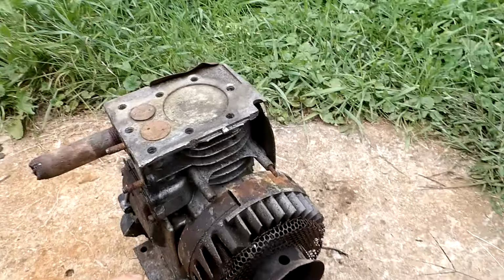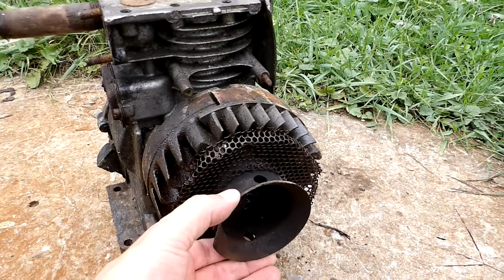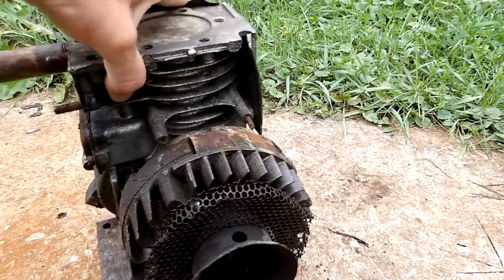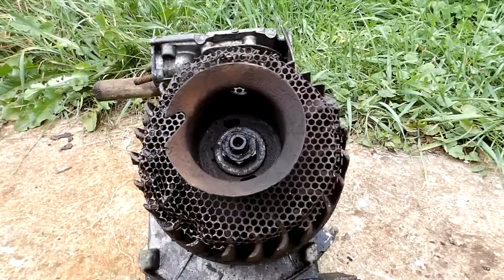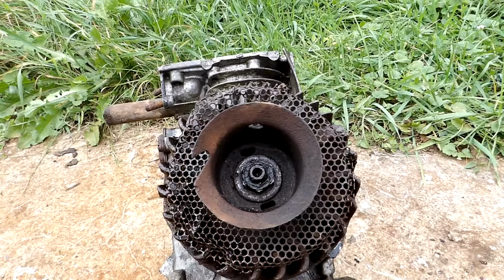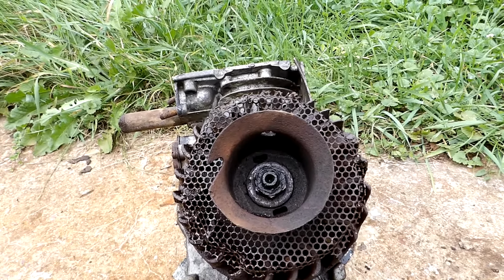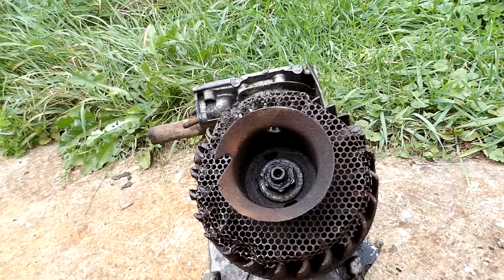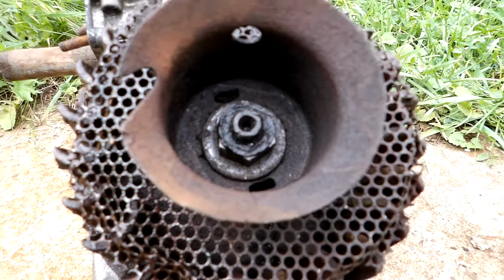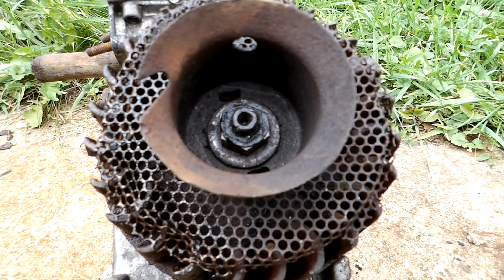and it's got the 2-bolt magneto mount. And you know, it's got this wraparound rope starter, but also the flywheel nut. Now I've been working on it a little bit, but it's 7/8 instead of the normal 15/16 socket that fits on it, and it's deeper. It's a deeper nut too. If you can see, it's thicker. So that's leading me to believe that it's a left-hand thread.